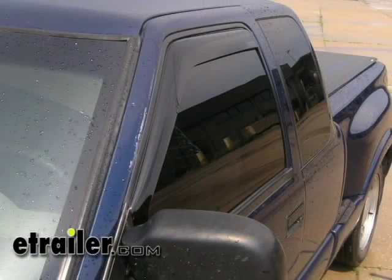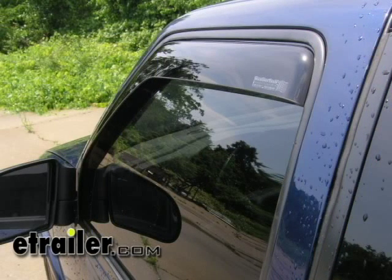Once we've rolled it up five times or so, I'm going to go ahead and leave the window up for 24 hours, and also try to leave the visors out in sunlight. Again, that'll help further seat the visor into the window sill and around the window.